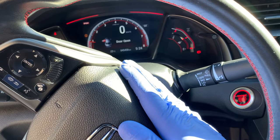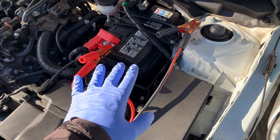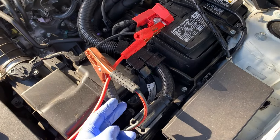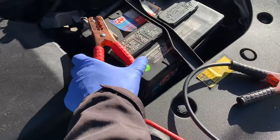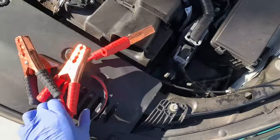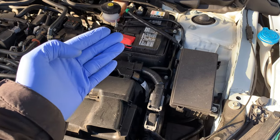We're going to leave the previously discharged vehicle running and turn off the other vehicle, then disconnect the jumper cables. You're going to detach your cables in the reverse order, starting with the discharged battery. Take the negative cable off and put it aside safely, making sure it's not touching any metal where it could ground itself. Then go to the good battery and disconnect the negative there as well — put that on a piece of plastic. Then disconnect the positive on the good battery, and go back to disconnect the positive on the discharged battery. Now with cables totally disconnected, set them aside. With your discharged battery, run the vehicle for at least 20 minutes to make sure it gets a good charge. Take it out on the highway, then come back and test the battery.